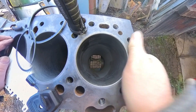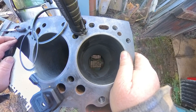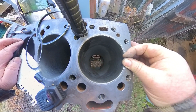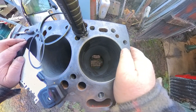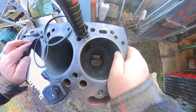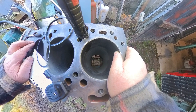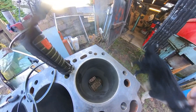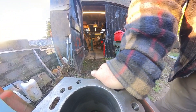If we left the ring in there with no gap or an undersized gap, when the engine warmed up — especially when the rings warmed up and expanded — the two ends would butt each other and the ring could possibly break. It would certainly be very tight in the bore and could cause bore damage, scoring and scratching. If the piston ring broke it would cause catastrophic damage to the bore and possibly other items as well. So please do your ring gaps — it's important. There's no point going to all this work and expense just to miss that little point at the end. Thank you for watching.